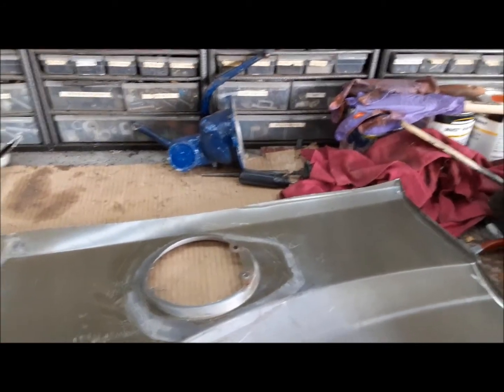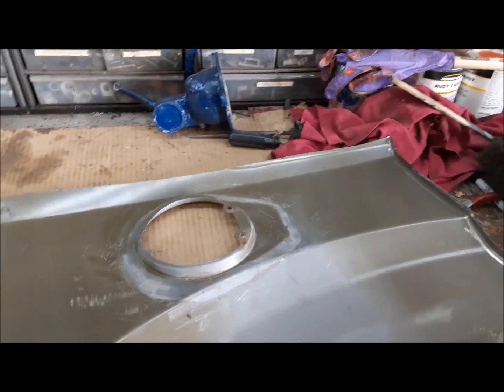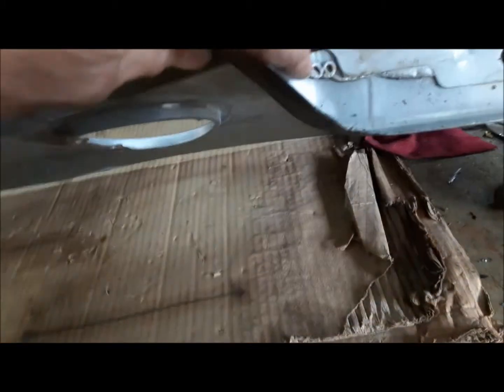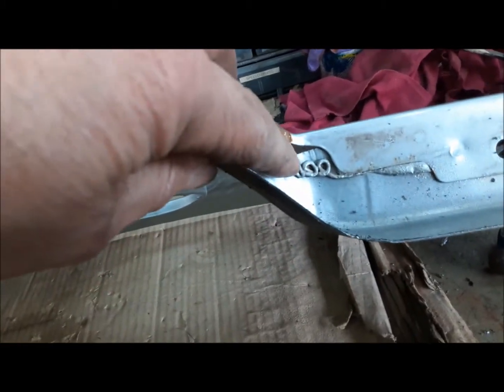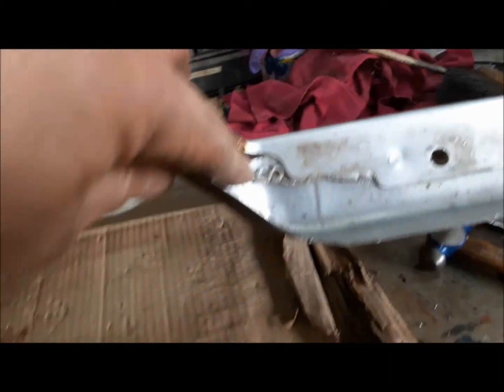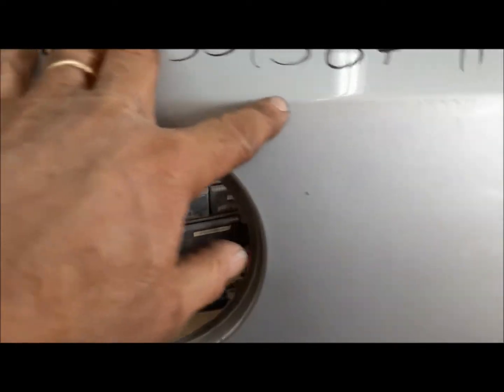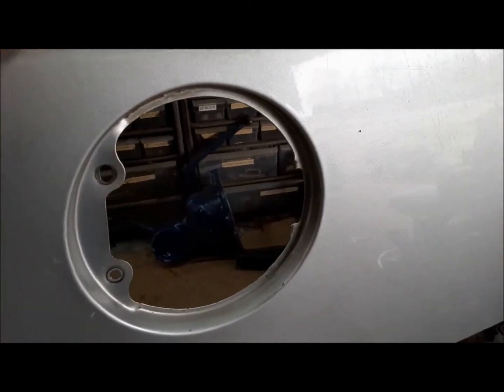So here's our patch panel - we finally got all the other stuff free of it. We cleaned off all the old seam sealer and junk. I've got one little rust spot to fix here, and look at that - the same hole to the inside of the car, just like our other side. I guess there's the sealer that's supposed to be in that void. Unreal. So anyway, we're going to take it around to the other side now and start fitting it on, and see where we're going to cut the top and where we're going to flange it.